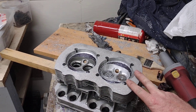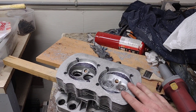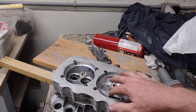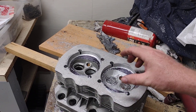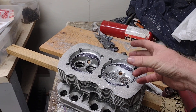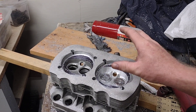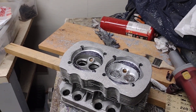To get the compression down there are three ways you could do it. The first way is what the gentleman who assembled the previous motor did — just start stacking shims. They had 145 thousandths deck height to get the compression down. The problem with that is combustion was no longer happening fully in the chamber; it was happening in the cylinder. You could see the cylinder was getting hot, the piston was rattling in there, and the oil control rings were just bleeding carbon through them. The ring pack was destroyed as far as tension and wear, and the piston was rattling at top dead center because combustion wasn't happening at the center — it was happening everywhere else.